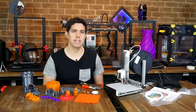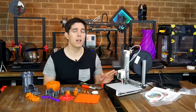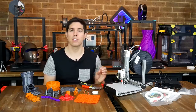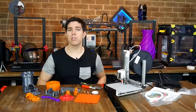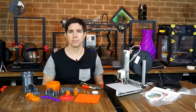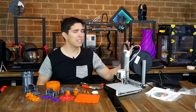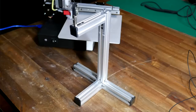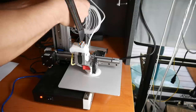After setting up an account, I tried to set up the WiFi, which was straightforward, but you should know you can only connect to this printer wirelessly if your computer is on the same WiFi network or SSID. For me, my main computer is connected via Ethernet, but for everyone else using a laptop, the WiFi feature works really well. I commenced printing with one of the sample rolls, which I hung off a rather elaborate separate filament holder that you need to construct from the included extrusion pieces.